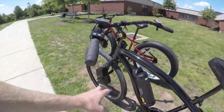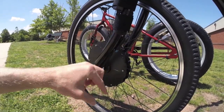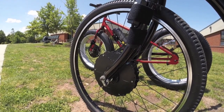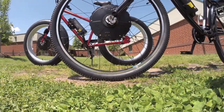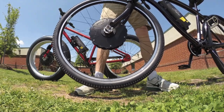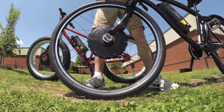There's your 500-watt direct drive motor. Inside there are big magnets, a stator — a piece of metal that electricity flows through — which repels the magnets and gives you drive. When coasting, the magnets still pass by that metal, which is how regen works. On some direct drive e-bikes this creates cogging, slowing you down so you have to fight the wheel. That doesn't seem to be the case as much with the Falco system. I'm going to demonstrate: I'll turn off the battery and spin the wheel — and it's spinning on its own pretty well, not a lot of cogging. That's something they tout as a benefit, and it's good to see for yourself.